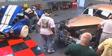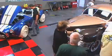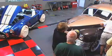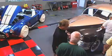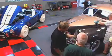What you want to do when you do these is I hold it like this and just kind of line it up. It's important to get it close, but it doesn't have to be perfect. With a rotary buffer, you want to be dead on accurate. With a DA, it's already making an oscillating action, so it's not super critical.